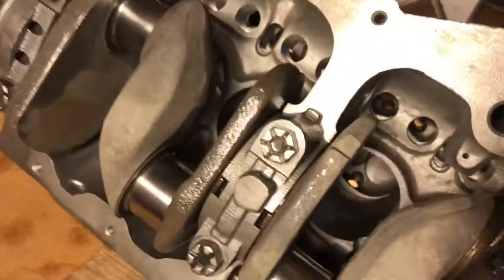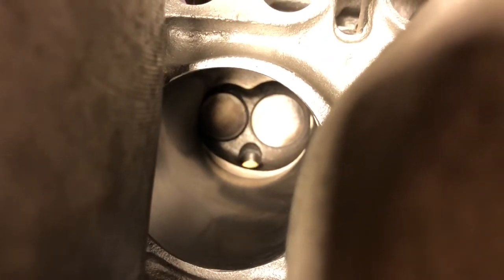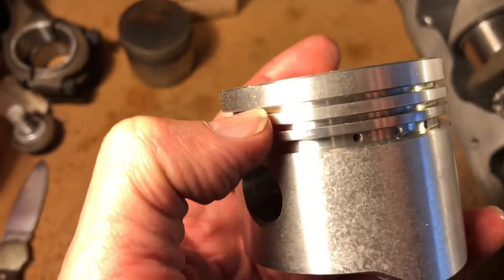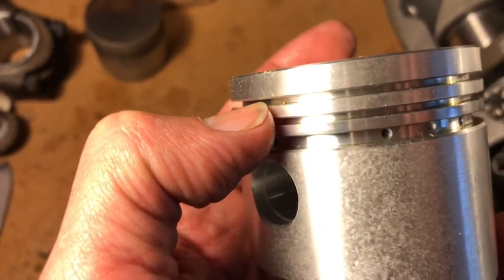Let me poke the camera in here and show you what I've been trying to figure out. You can see the combustion chamber for number three cylinder. I've popped the springs off so I can open the exhaust valve — and it is just touching, maybe 20 to 30 thousandths of a notch. When I say a notch, we have to be careful: you don't just chop away.